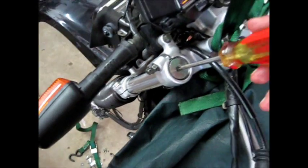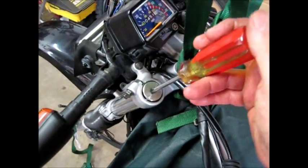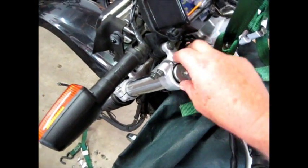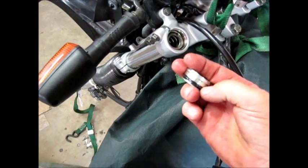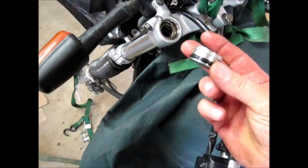With some real spring tension on the cap, the snap ring already out, I put a screwdriver on it and tapped the top about three times. Because it was under spring pressure, it did fly out of there. Before you do this, go to Yamaha and get two of these O-rings just in case you mess them up.